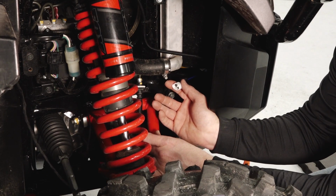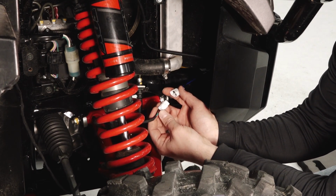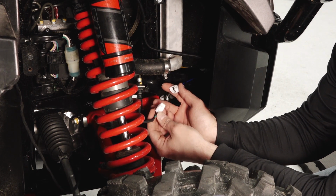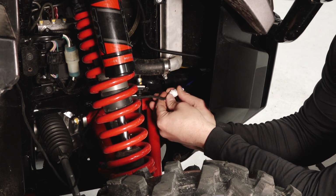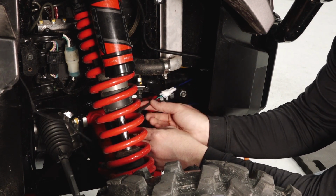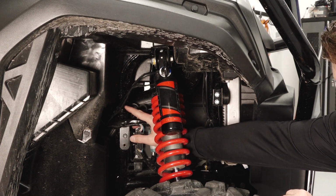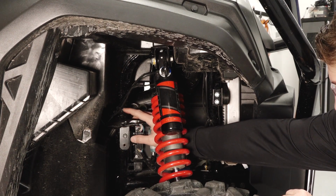Locate the second connector off of the winch contactor harness, and then connect the white connector from the rocker switch together. This will connect both switches to the winch contactor. Secure the rocker switch harness up along the same path as the corded remote using 3 plastic cable ties.